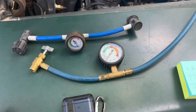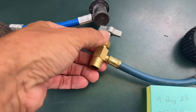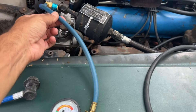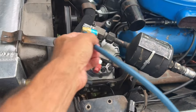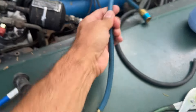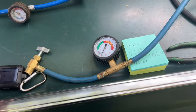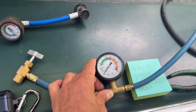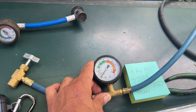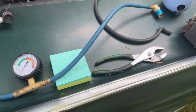So I'm learning as I go. I've done this before where I check my pressure without a fill can attached just to see what things are looking like. Later on, I'm going to attach this to the low side — that's where you fill from. It only fits on one port, and that's intentional. I'm just curious to see what the reading is showing me, and if it's lower than it should be, I'll go buy a can and put some more R134A in it.